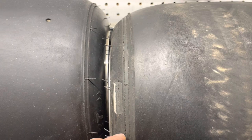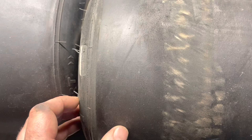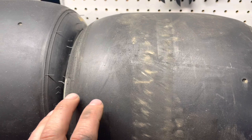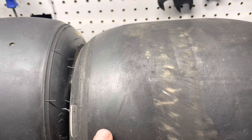This was run on a super soft track, a super soft durometer, and a bit lower air pressure, and I have torn up the top of the sidewall here. I haven't cleaned this tire all that much because it lost some speed after the last run. Can I use it? Can I flip it? Absolutely. But this is what happens — that dynamic, that push and the ballooning of the side — when you run super low pressure on your tires, this is what can happen. You can tear up the sidewall, make it look not so pretty. And I think the tires do lose some speed from that, so be careful when you're doing that.